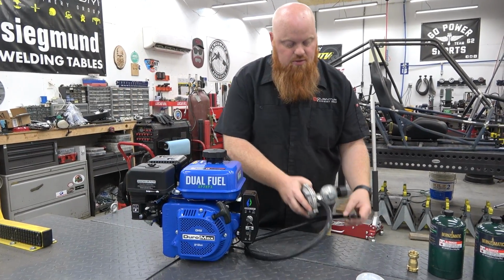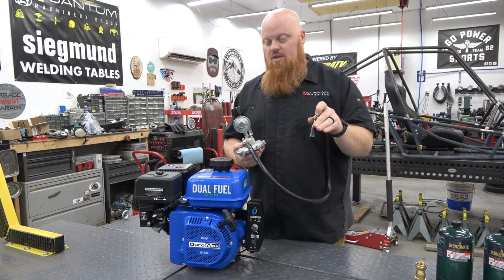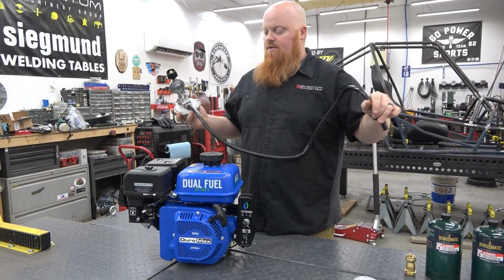All we do with this is there's a barb, like I showed on screen, for the carburetor. We put this on it, tighten up the hose clamp, and we've got to purge this. We've got to burp it to make sure all the air is out of it, and then we can start this thing up on the table and hear it run.